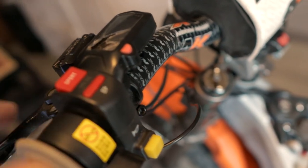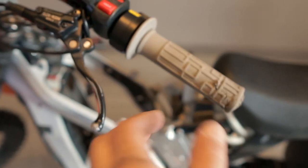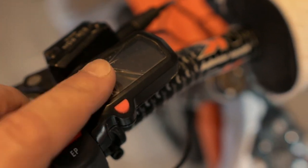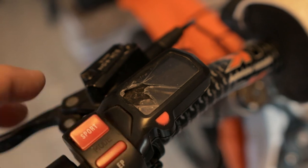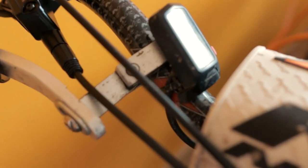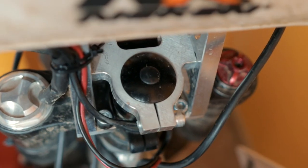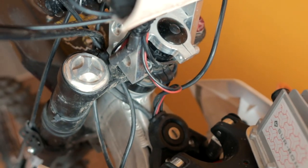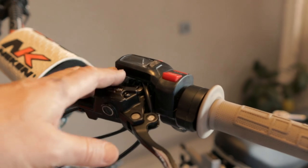This regeneration brake lever we mount here to work with the big finger on the left side. It's better to mount it before installation because after, the wire may not be long enough. I like to place everything to work with the brake using one finger, while still having space to push the regen brake lever. As you can see my friend's speedometer is broken. If you don't like the stock place for the speedometer, you can disconnect it from the eco sport mode switch and place it in a safer location on your bike — I can show you how I placed it on my bike, which is much safer than stock. You can even mount it in the stem area for even more safety. It seems like they mounted it in that stock location especially to sell spare speedometers.